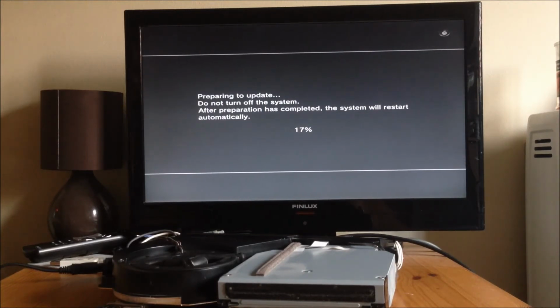Now sometimes you might get problems where packages don't run. It might be Toggle QA that doesn't run, or you might even just go to install a package and it'll say that there's no packages on the USB, even though you know that there is. That could be one of two things: either the Blu-ray ribbon on the Blu-ray drive isn't plugged into the motherboard properly, or the ribbon on the FATs that goes from the USB ports into the motherboard, those ribbons may not be plugged in correctly.